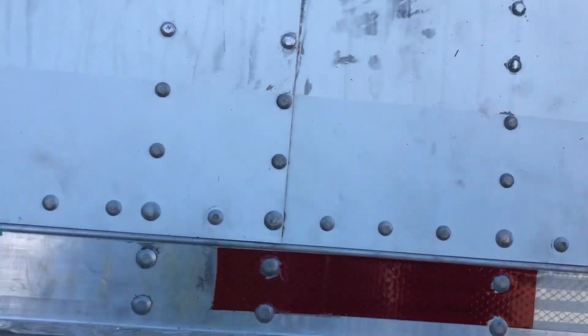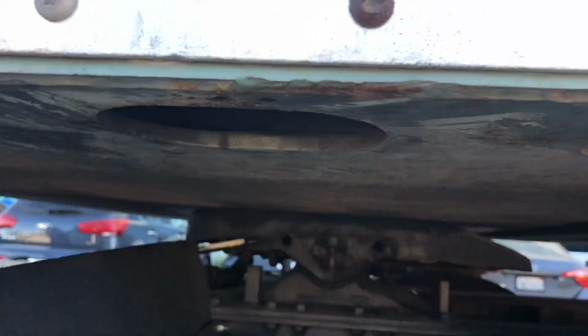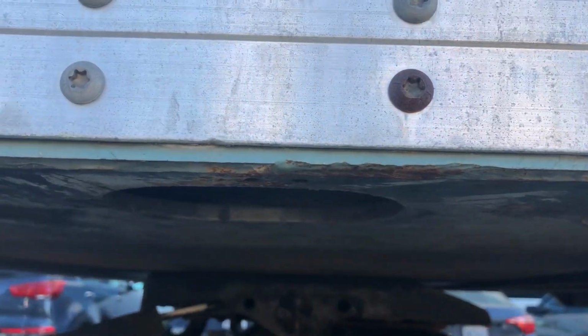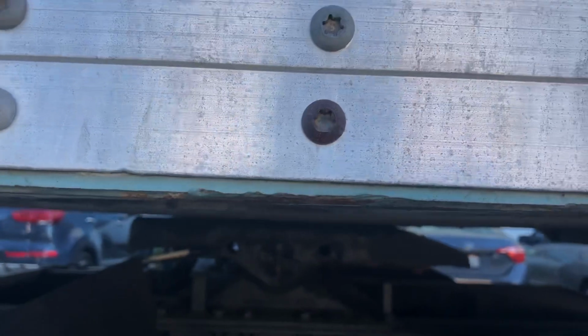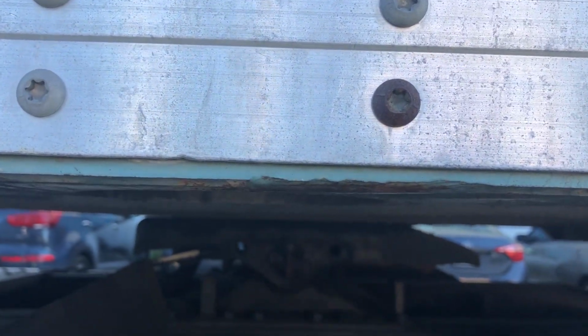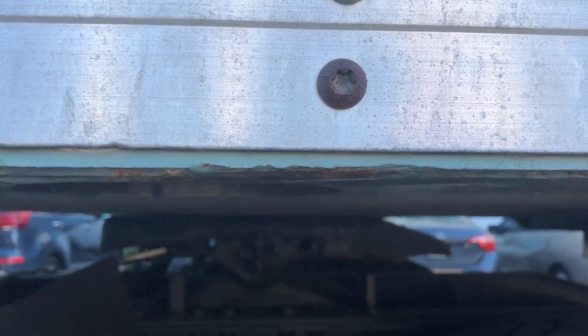Going to go ahead and jump down to our fifth wheel assembly. We want to check our apron up here on the top, making sure our apron's in good condition, the welds are proper, it's not broken or cracked in any way. Now when we look at our apron across our fifth wheel skid plate, we want to make sure we don't have any daylight or any gap in between there. If we did, that can indicate possible damage and we would need to be serviced, okay?